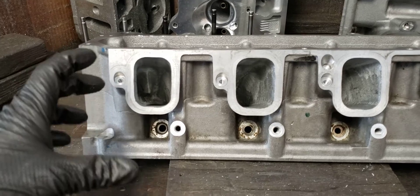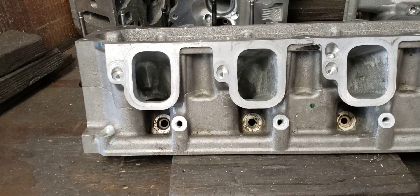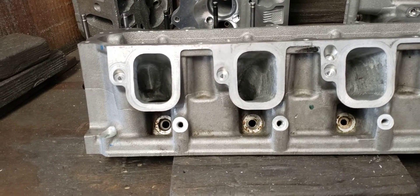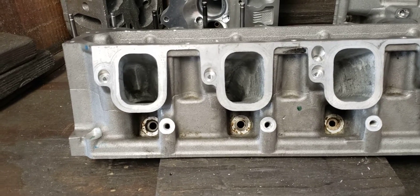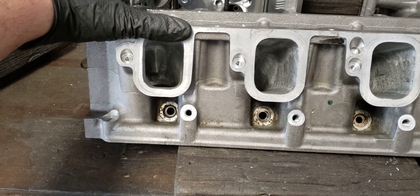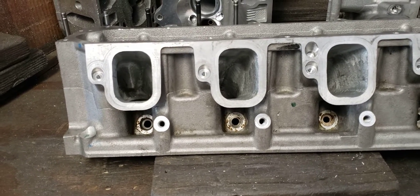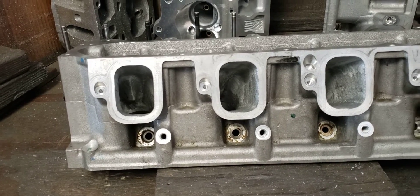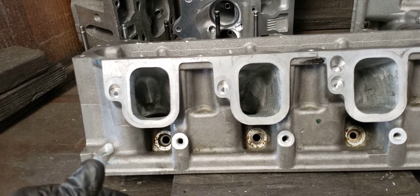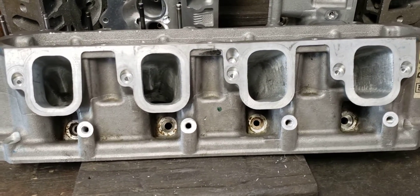With this, we need to create velocity, but up front I need to create more space in the intake manifold to draw more air. That leads into a whole other discussion of dynamic flow versus static flow — I'll cover that in a follow-up video. The stage 1 head: I don't touch any of the vertical, so with a stage 1 head I can't give you a stage 2 ported intake manifold — it simply won't fit and won't be conducive to what we're doing. There's also short turn work that's different in the stage 2, and some pinch point work to smooth out the transition and prevent any port flow crash.